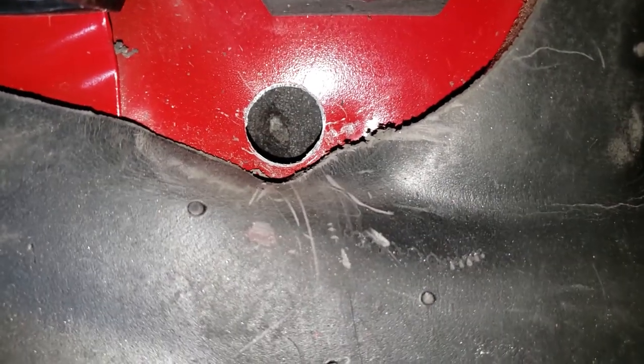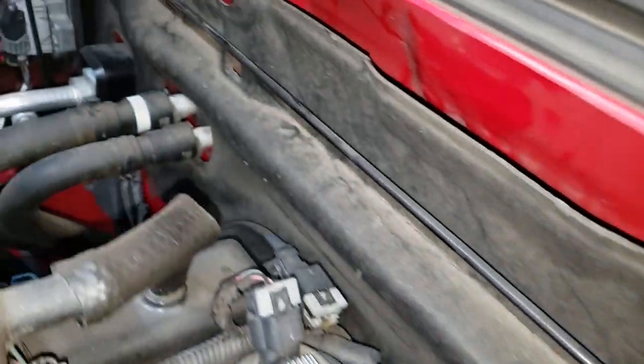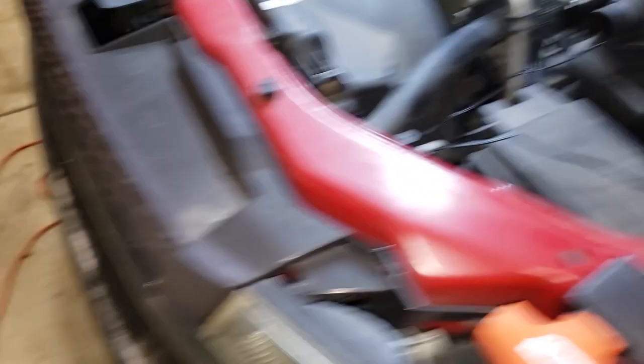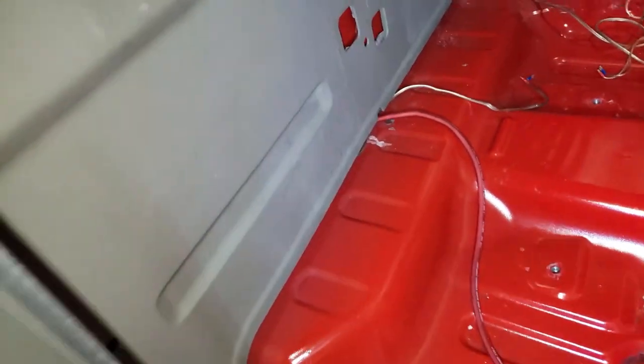We've got a nice hole. I'm going to put a grommet in there and run my wire through it. I've decided to go behind the protective layer of the firewall and just take it apart right there so I can run along there and drop down. I'm feeding it on one side and when it binds up, I jump around to the other side and it pops out all the way down, coming out my nice new grommeted hole. I've got enough to go back to the back wall where I think the amp is going to end up.